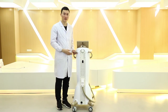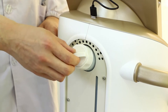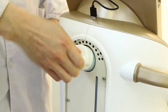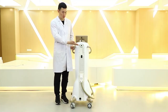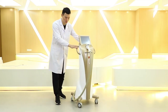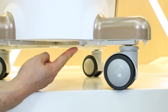As we need to change the distilled water every week, now I will show how to empty the distilled water. Step 1: we need to uninstall the cover of the water tank. After taking off the water tank cover, we can find the water releasing hole on this side of the machine. This is the water releasing hole.